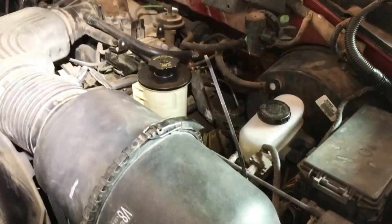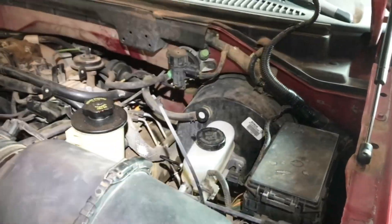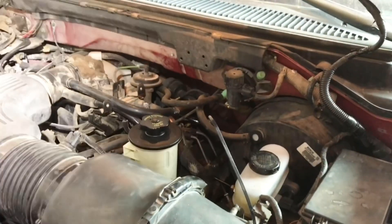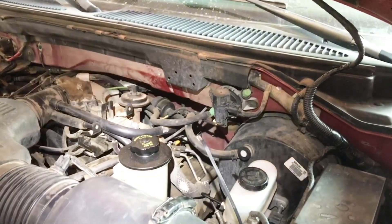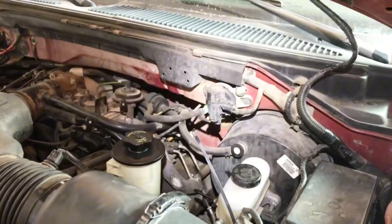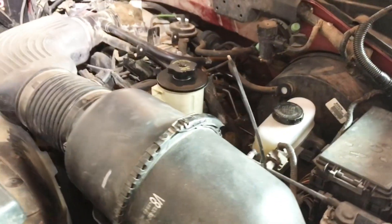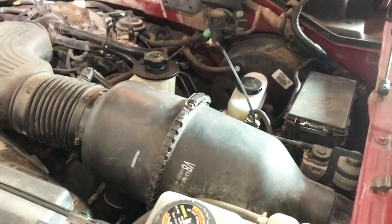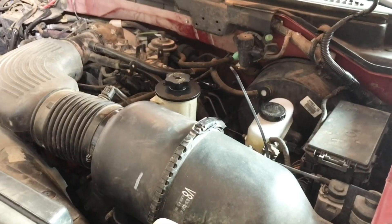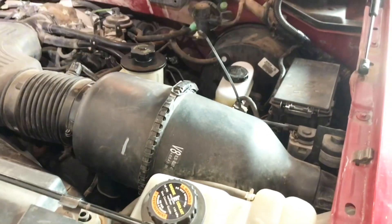With the pump disconnected, you will still have brakes. Your brake booster will still be working. You'll have brakes, you just won't have anti-lock brakes. You may also notice a kind of pulsation in the front brakes when you're applying them at higher speeds. It's something you ideally want to get fixed. You can drive around indefinitely without ABS, but that pulsating brakes is kind of annoying — not super aggressive, but a little annoying.